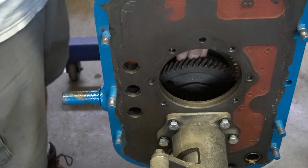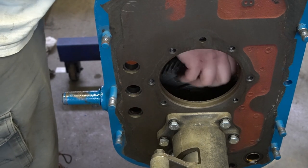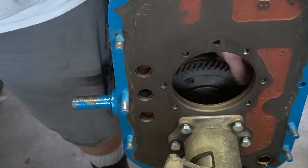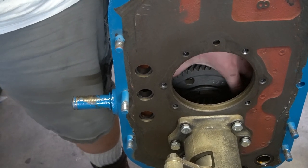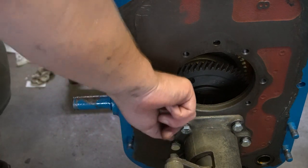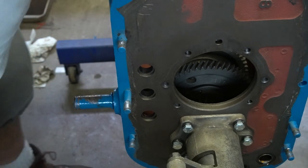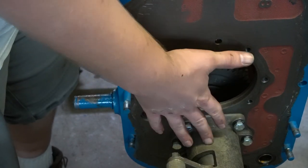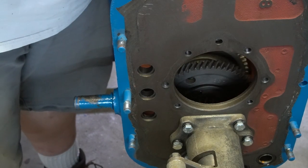Here's one thing I was afraid of - I cannot even turn this gear. That's just the slop in the gear itself, but this main shaft is locked up because there are no shims here. I have no shims, so I'm going to have to try to locate some shims to space this out and get a preload in here where this shaft will actually spin properly.